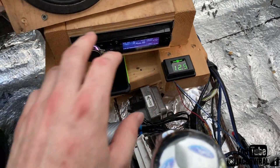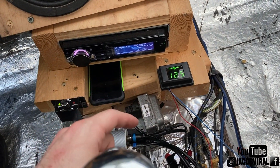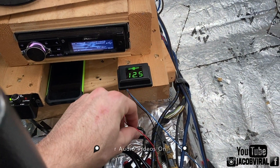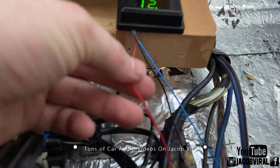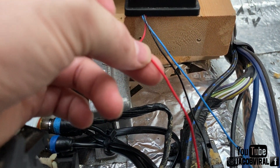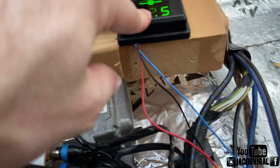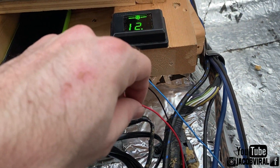Always have a voltmeter for your system. Now I'm going to go into how I wire this, and you guys can let me know in the comments if you agree. So where do you run your power supply from? A lot of people run it straight to their head unit power, which is a no-no, because how do you know what your voltage is at the back of your amplifier? Your amplifier is where it's going to be causing the most draw for your current. So your power wire on your voltmeter — regardless of what kind you have — your power wire is the most important location point. I would never wire this from the head unit because your amplifier is pulling the most current.